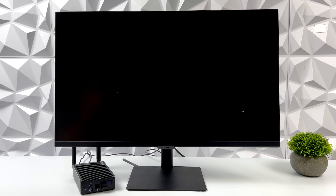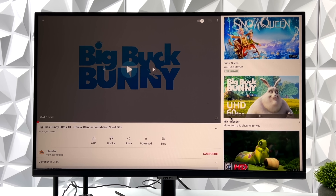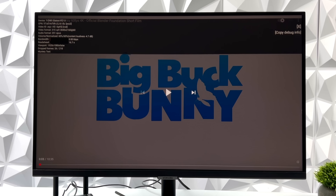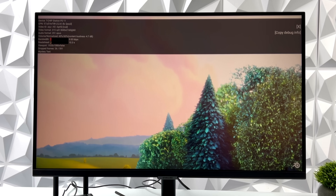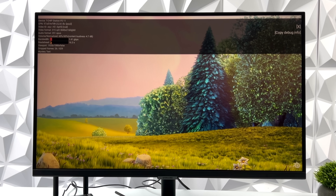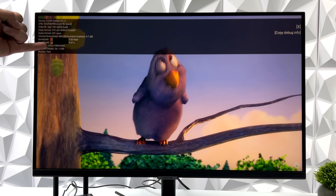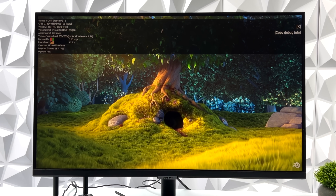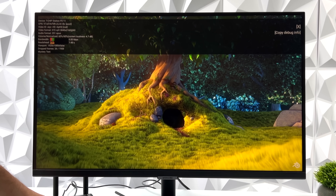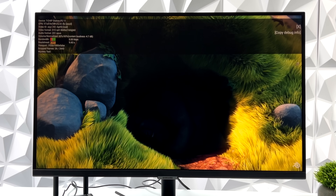I want to check out some 4K video playback from YouTube. I've got Big Buck Bunny going at 4K 60fps with Stats for Nerds on. Overall, really impressed with the video streaming performance of this chip. We had 25 dropped frames on the initial load-in but through the whole video I didn't drop any more. Our viewport is at 1080p because that's my screen, but the video is playing at 4K 60. By the way, this is pulling only 9 watts from the wall — relatively low power for 4K video playback.